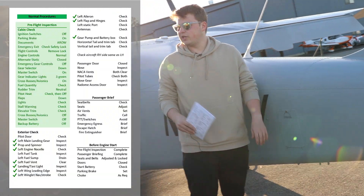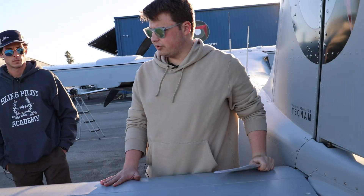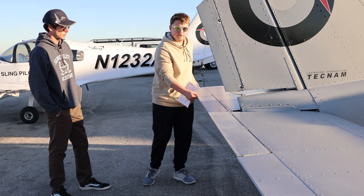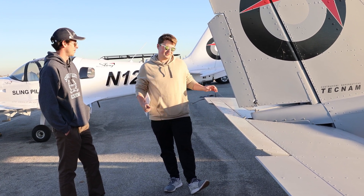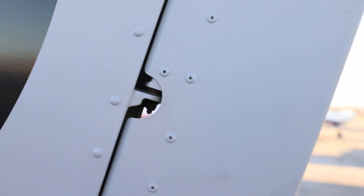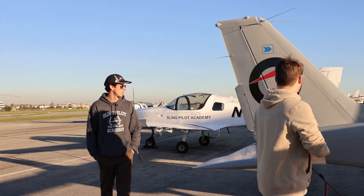There's a little case to protect the batteries back here. Next, we're going to check our vertical stabilizer — double-check no damage on the leading edge, anything like that. We've got our two VOR antennas up there, looking good. Now the stabilator — this is a big one to check. Kind of like we do with the ailerons, we're going to do some full deflections: all the way up, all the way down. Want to make sure there's no resistance, that it's moving free and correct. We're also going to confirm that the anti-servo tab is moving with it — this helps relieve some of the control pressure. Looking inside the two crevices on our rudder trim, we're going to double-check that we can see threading on these bolts, making sure everything is fully secured and not going to come off as we start up.